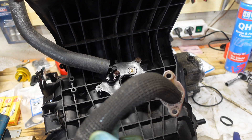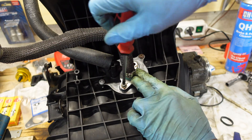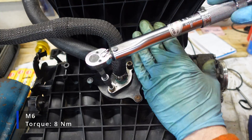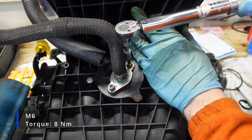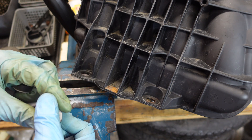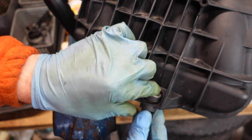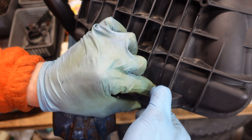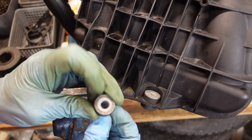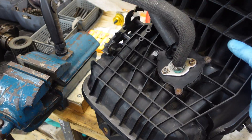Next, I'm going to reinstall the connecting line. I'm also going to insert these rubber bushings — they are two-piece construction and the manifold gets sandwiched between the two rubber parts. The flange has to point towards the top, and the intake is ready for installation.